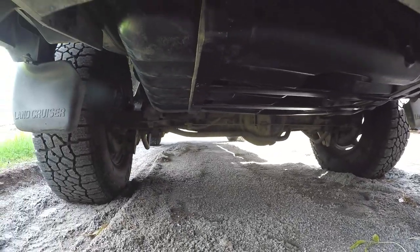If I was going to do some more serious off-roading, a stainless tank would be great so you don't puncture it. But I've also done some provisions so I can mount a guard underneath it so I don't damage the tank. And on that note about damaging the tank, it's a good idea not to have all your water in one source when you're doing some remote touring. I've also got another swing-away carrier — I can put some water on there, so if I do puncture that tank, I've got water so we don't go without.